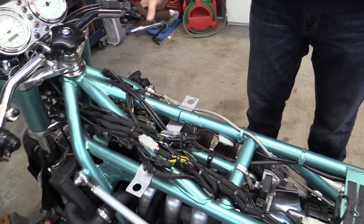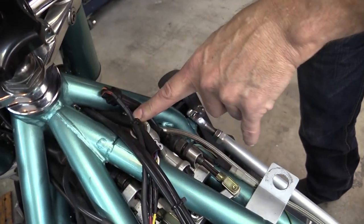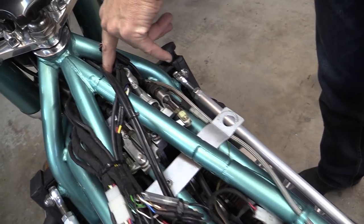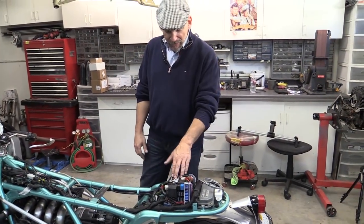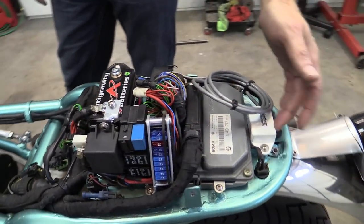The mechanical effort and the advantage is very high. You have a master cylinder here — this is for the clutch because it does have a hydraulic clutch — so you have the hydraulic clutch cylinder. Here's the master cylinder for the brake, and then there's a slave cylinder that pulls the two brake cables. Everything is back here: the battery, the start circuit, fuse box, relays, Motronic, and the speed sensor.